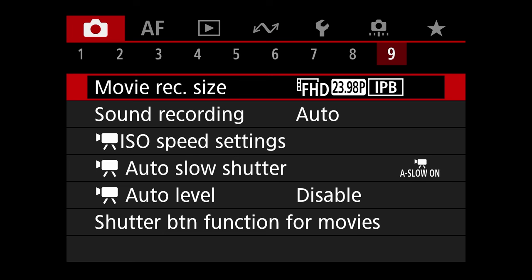To see the menu again: flip it to the on switch, change your mode dial so the white line lines up with M, then press the menu button. If you don't get anything showing up, your camera has gone to sleep to save the battery. Just press down on the shutter button to wake it, then hit the menu button again.